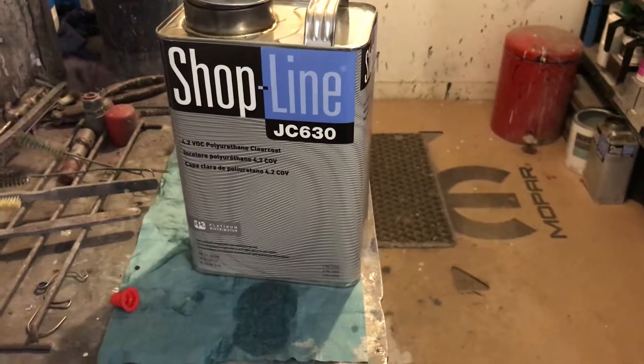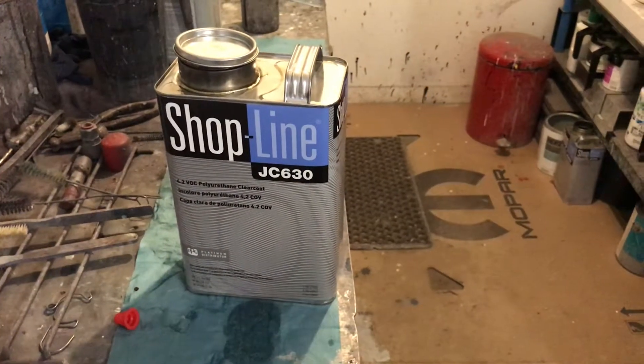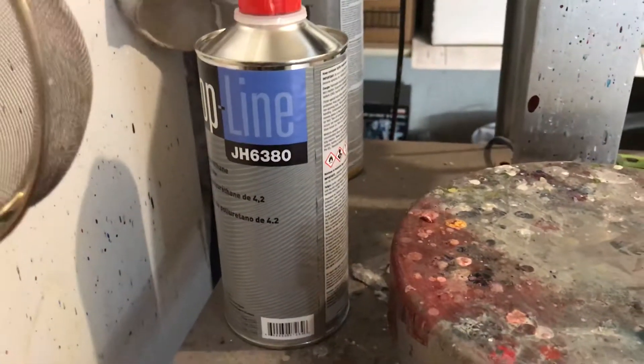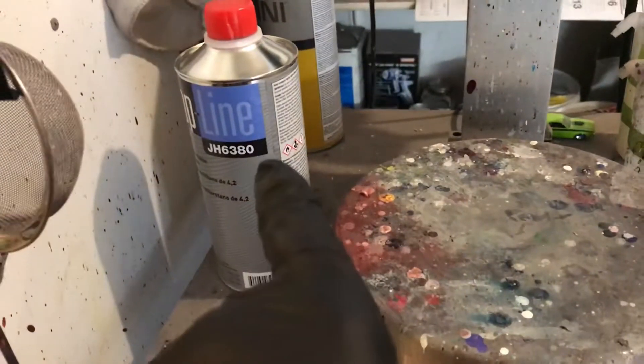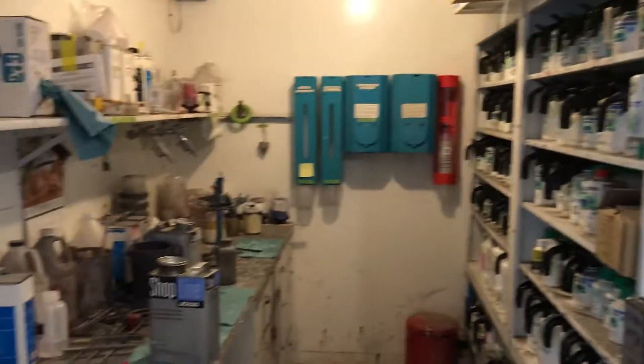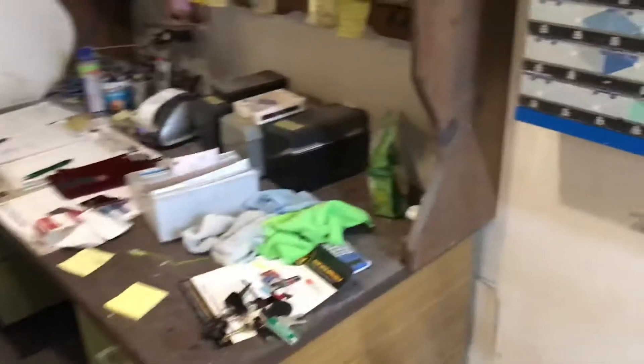It's a nice clear. You put two or three coats on it and it's a really nice shine. Sometimes you have a little issues with the different kinds of hardener you put in there. That 80 number pretty much tells you the degrees you're spraying in, and it will dry differently with different temperatures. It's just one of those things you learn as you go.